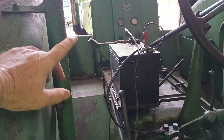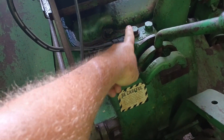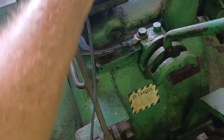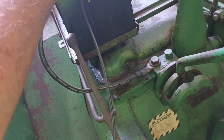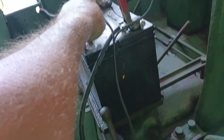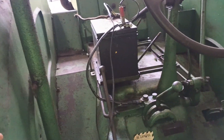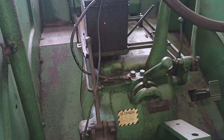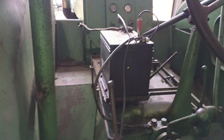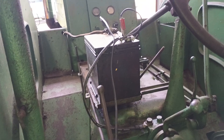It's positive to positive, negative to negative, regardless of what's grounded when you're going straight to the battery. Now I can move this positive lead down here onto the ground and it still will charge because this wire is connected. So I could put this positive lead anywhere, I could put this negative lead over on the starter and it would still charge just the same. But I don't dare put that positive lead on the starter and a negative lead on the ground down here — now you're charging backwards. You'll ruin your battery, probably burn up your battery charger.